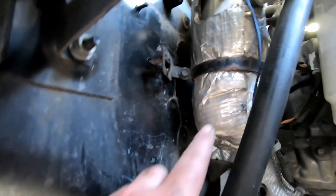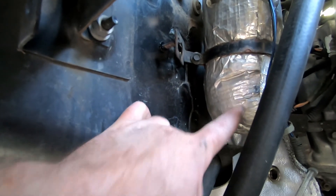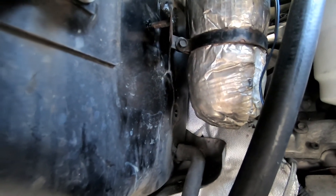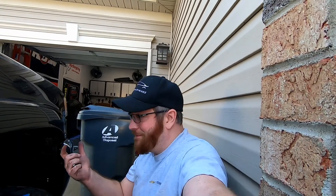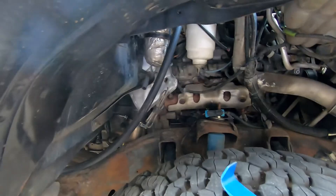We have the blanket fished back here, but I was running into a problem with the AC part. There's actually a bolt right back behind the air conditioner component — it's kind of on the bottom, back behind it. So there's a hidden 10-millimeter bolt there, and that might be something you guys run into. To get access to it, I had to remove the splash guard. I'd recommend taking the 15 minutes to remove both splash guards — you'll get access to the sides and you would never know that bolt was back there otherwise.